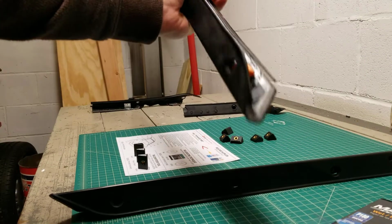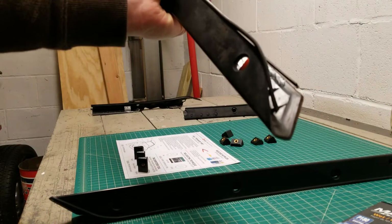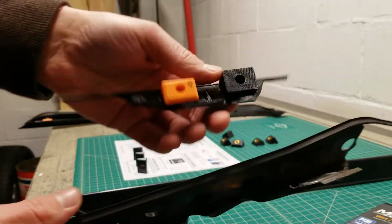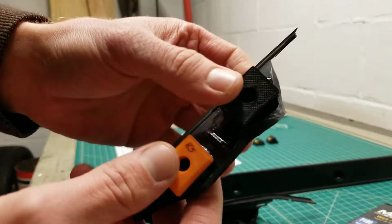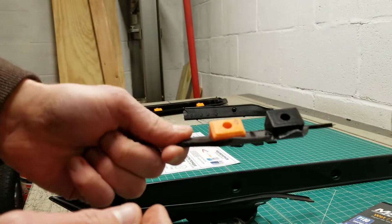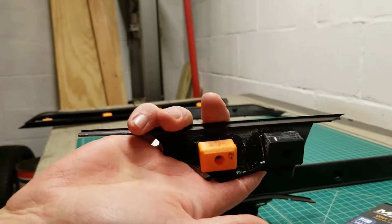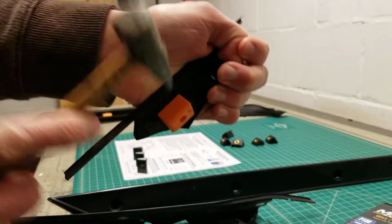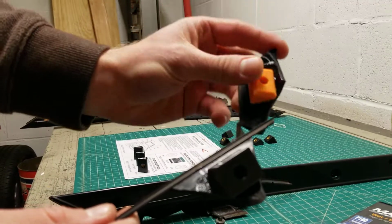So I could continue hitting this even harder, but it's basically what you'll find as you hit this. You guys probably won't do this, but if you start hitting this thing harder and harder, what happens is that these things will separate, and this glue is strong enough that it'll break around the trim bosses. So these things are not going to come out. When this broke out, I was hitting the tabs, and it was such a strong connection that it broke the rest of the trim and the tabs stayed connected. So your trim is still brittle. It's still likely to crack, but it's not going to crack where these are connected. That's going to be your last failure point. Hopefully that shows you how strong these things are. It'll continue to break as I hit this thing, obviously, because this is a really, really old crusty piece, but they're not coming out of there.